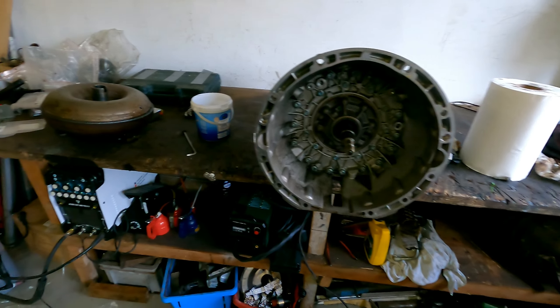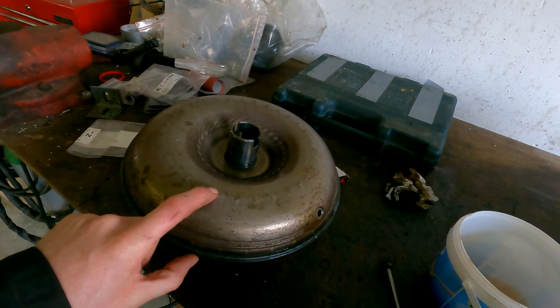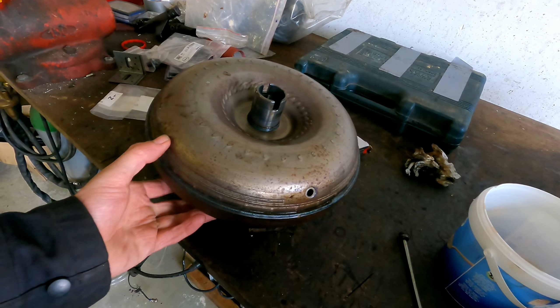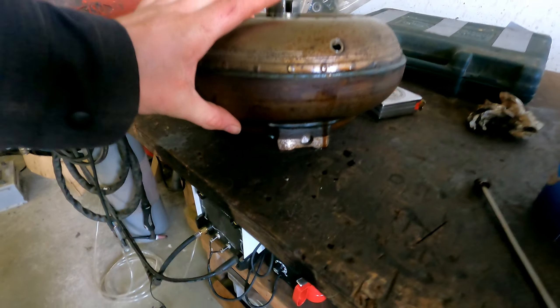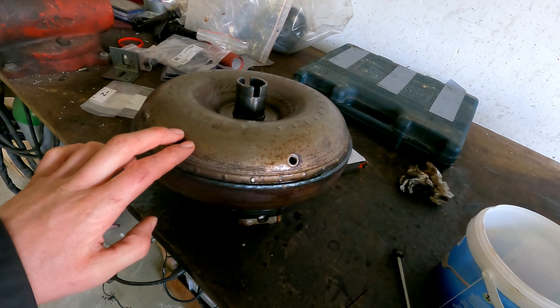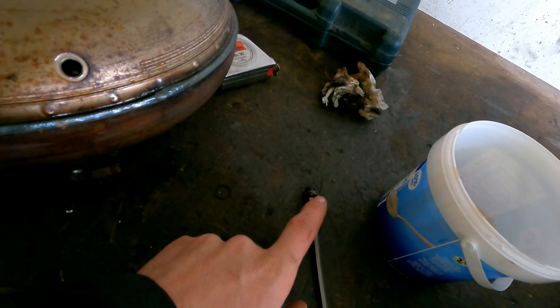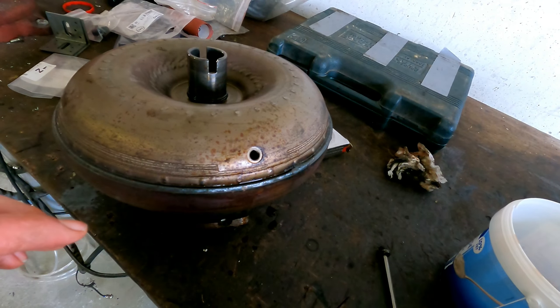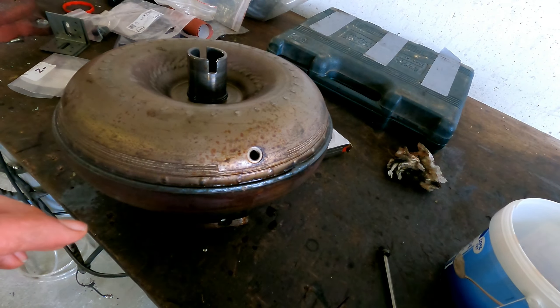I just put the torque converter back in after draining the oil. On the earlier versions you have a different torque converter — it's a little bit fatter and bigger and holds more oil. Most of them, like the V8 versions, also have a drain plug in them. I think it changed around 2000, but if anyone knows please put it in the comments. These old ones have a drain plug — I think this one is from 1999 — and there's a massive load of oil in it.